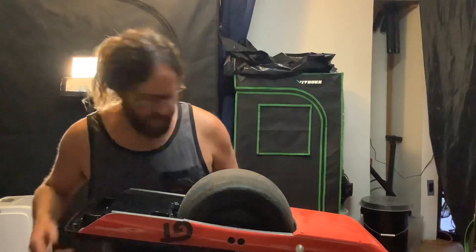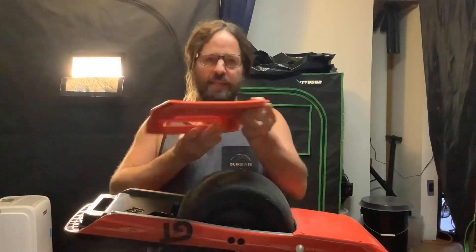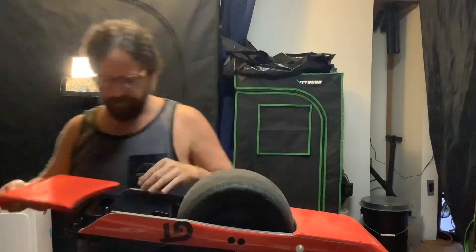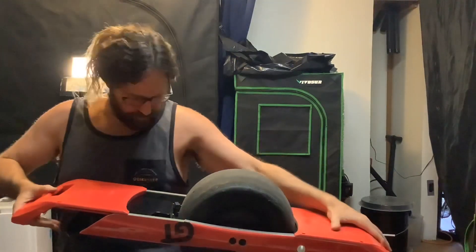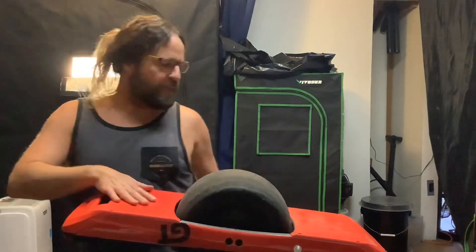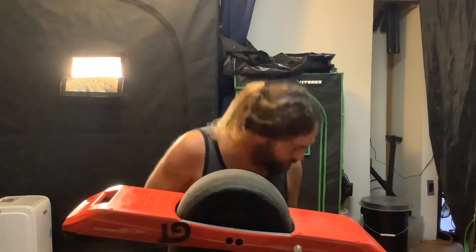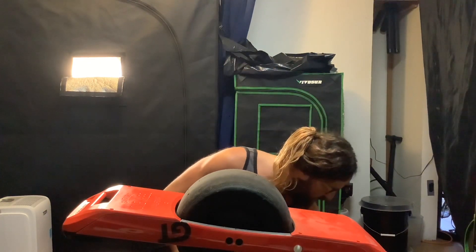From here we're going to add the front bumper back on — it just slides in, you can see the little notches right there. Also, anytime you're putting a bumper or anything on the One Wheel that requires more than two screws, don't tighten all the screws as you go. Put one screw in halfway, another in halfway, and so on. That way everything lines up — sometimes if you tighten the first screw fully, your second or third screw won't line up to the hole.